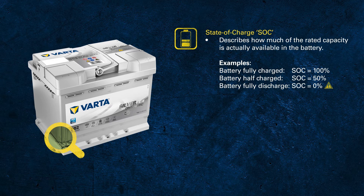Unfortunately on an automotive battery we don't have such an indicator. To determine the state of charge of an automotive battery you have to do two things. First, measure the battery voltage. For highest accuracy it is always recommended to measure directly from the battery terminals in order to avoid any bias through the wiring.